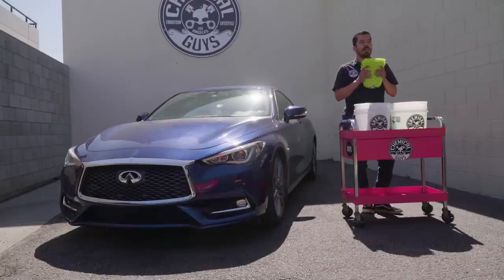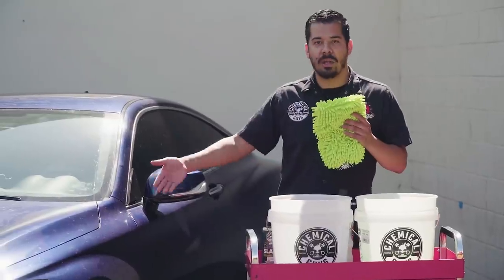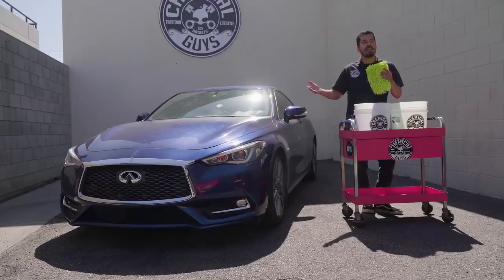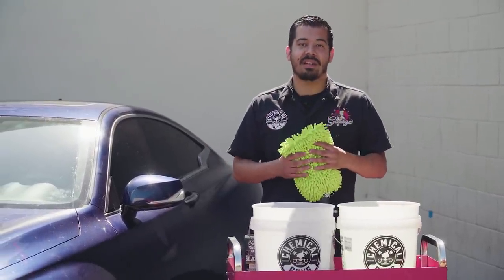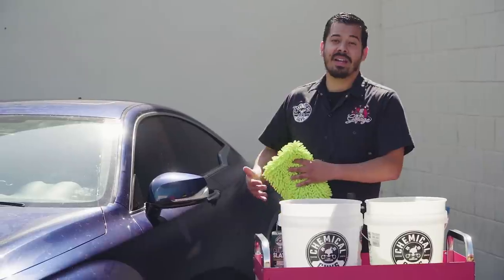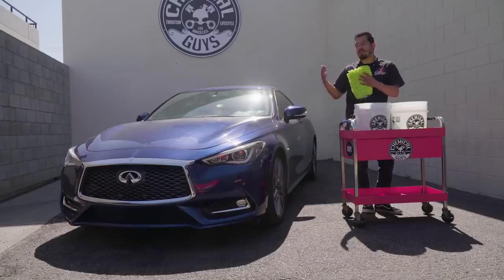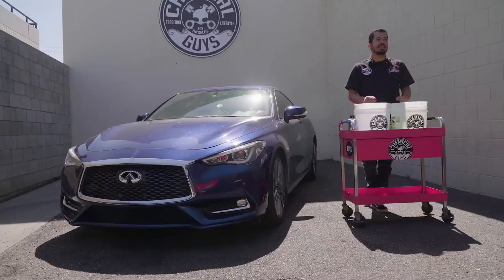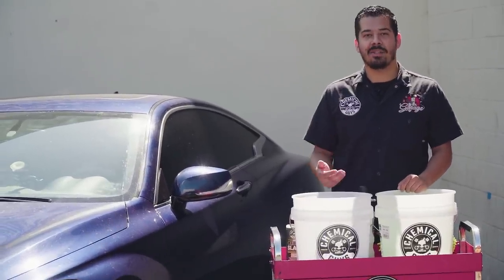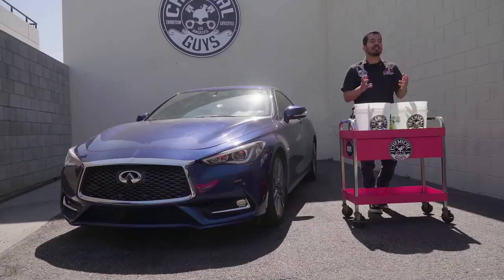Lastly, we're going to be utilizing our Chenille wash mitt. This wash mitt works out great because it's going to agitate any kind of dirt and grime that's on the vehicle without forcing us to apply any aggressive motions so that we don't scratch the paint. The main mission here is to clean the vehicle without installing further scratches and swirls. I know we are going to be polishing it, but it's always best to wash it properly so we don't cause any further damage. The last thing I want to mention is we are washing outside in direct sunlight — that's completely fine because we are using deionized water, which means there are no minerals in the water that are going to leave any stains.